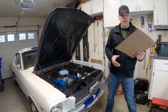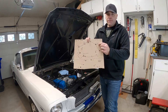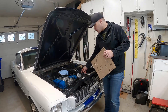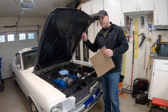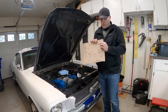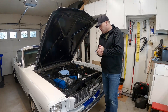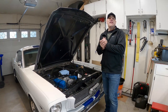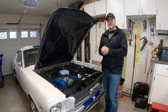I also wanted to point out that on the cheat sheet I made, this bolt right here says 1.25 inches — it should actually be 1.5 inches. That's the one I over-tightened because it wasn't threading in far enough, and I stripped the threads right out, which is why I had to put a longer bolt. So use a 1.5-inch bolt there. That's how you do a water pump — on to the next project. If you like the video, give me a thumbs up, and subscribe if you can — it helps the channel out.